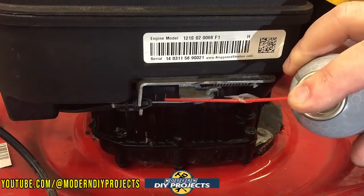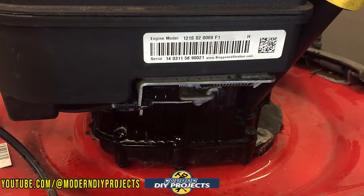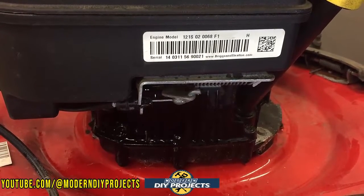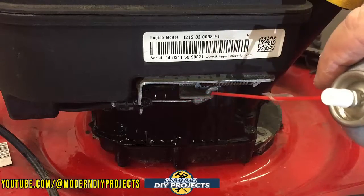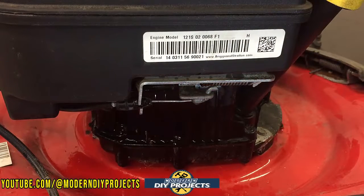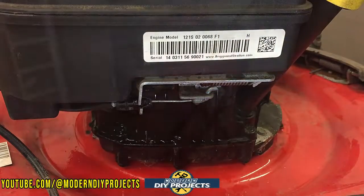Just a little WD-40 or something like that — shoot it right into the cable itself. This is something you should do every so often; a little bit of maintenance and you'll be good to go. A little bit more at the top of the cable and I can already feel it moving so much more freely. If it still doesn't go back far enough, the cable can be adjusted at the top to take out some slack, since binding over time may have stretched it a little. A little lubricant every so often on that cable will save you a lot of headaches.